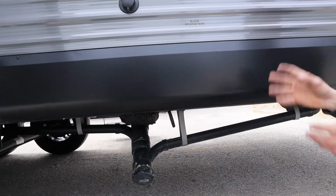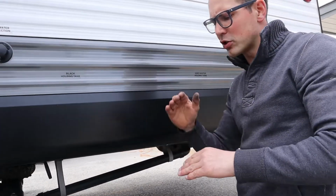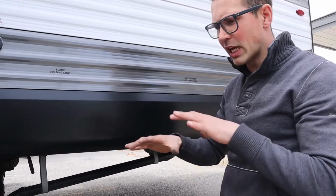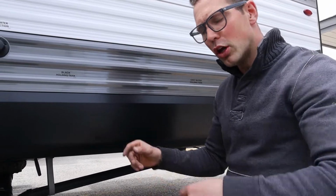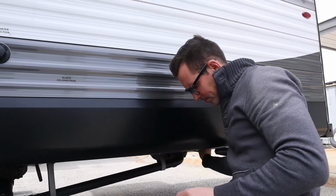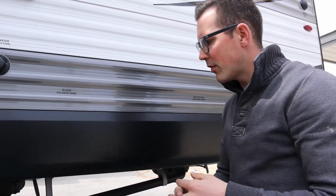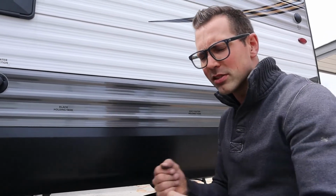Okay. The reason we have the black water closed is if you leave it open, the liquids are going to run out and the solids are going to build up on the bottom of the tank. That's not good. So you leave the black water closed, and the liquids and the solids build up together. Once the black water tank is full, you're going to come out here, close your gray waters, and open your black water. It's going to flush it all at once, okay? That's how you handle that. You only have the gray water open or the black water open. You don't have them open at the same time.